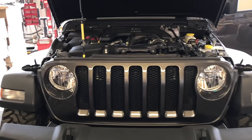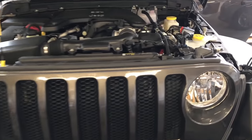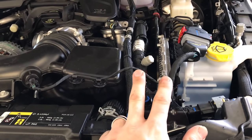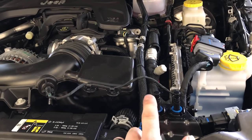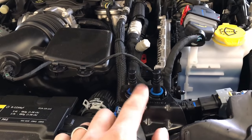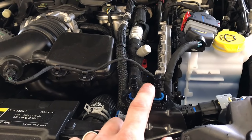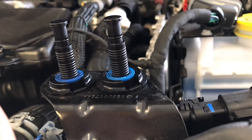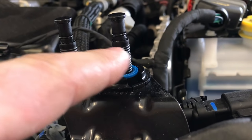It's pretty simple. All you have to do is open the hood. Once you have the hood open, go to the driver's side — there are two plungers. This one runs pretty much everything else: it tells you the hood is open, gives you warning lights, and all that. This other one so far is only linked to auto start-stop.